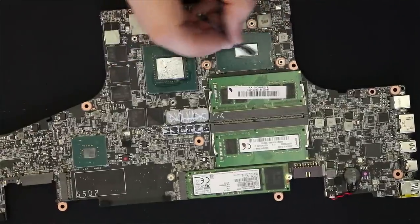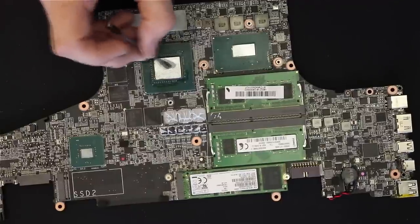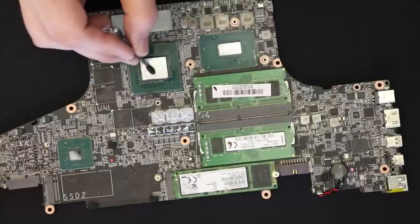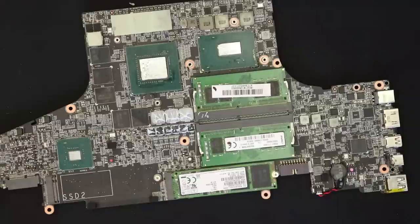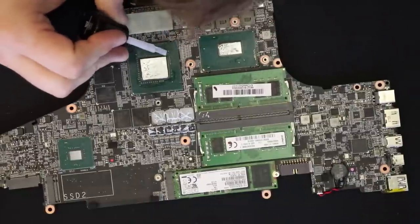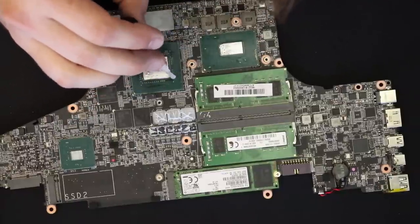Just use this video as a guide and go in the opposite direction. One of the big things I did when I put the cooler back on — I placed it on and screwed it in first before I plugged the fan headers in. Let's wrap it up with some results. Initially when I ran the stress test I was hitting 90 degrees C right off the start and was actually thermal throttling up to about 30% throttle. After this mod, I was able to drop it down into the 60s. Under full GPU and CPU load it got up to the 80s with no thermal throttling at all — I'm extremely excited about those results. If I turn the cooler boost down on the laptop I was able to get it down to 50 degrees. My whole reason for doing this mod was to make it quieter — I didn't want to edit or game on this rig while it was just screaming fan noise. As I finish up, I'm throwing a little bit more nail polish on just to protect if anything comes off. Have a good day y'all, see you in the next video.